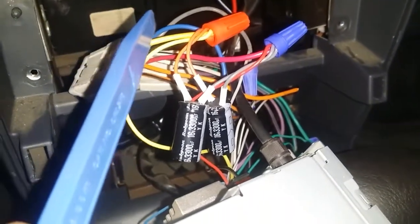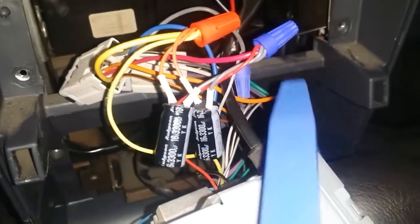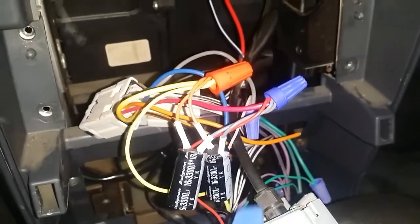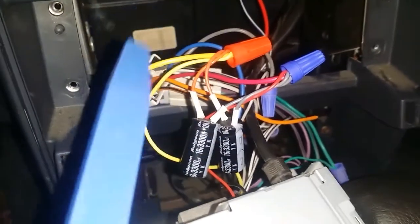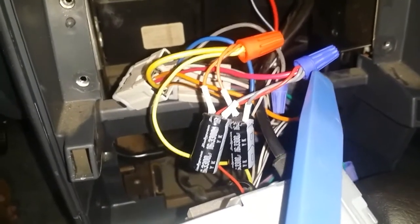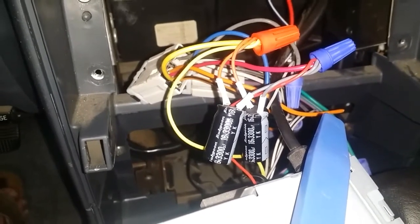What I've done here is wire two capacitors from the always-on power going into the non-stripe (positive) side of the capacitor, and then the stripe or negative side going over to the accessory line. So you have the voltage coming in to the stereo for the accessory signal, but you also have these capacitors. The way capacitors work, the voltage does not travel backwards. I tried running the capacitor just on the accessory side, but there just wasn't enough push current to actually charge the capacitor to keep the thing running, so I wired it up this way and everything works.